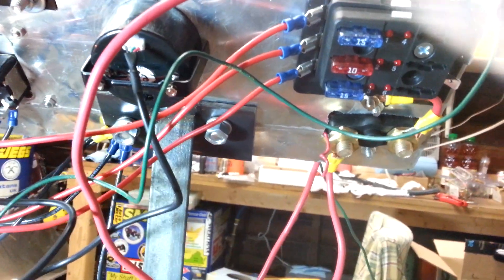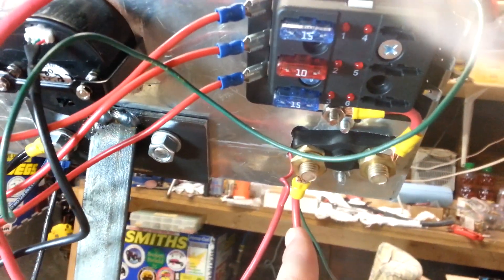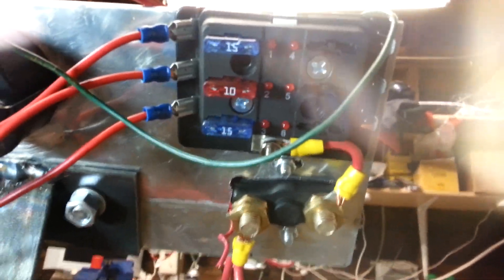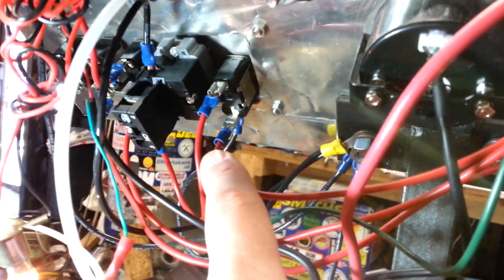Let's go to the back side and show you real quick how this is wired up, and I'm going to give you the scenario of how you would use it if you were just using it to bypass your keyed ignition on your automobile. I've got 12-volt positive fused coming into this — it comes out this side and goes to the stud on my six-terminal fuse block. In my application, the top one goes to the lit master switch here. In your application, you would want to make sure this was 30-amp fused. At the very bottom here you can see there's a ground wire — that's what gives you the nice little LED. If you don't hook up that ground wire, you don't get the pretty LED when you turn on the switch.